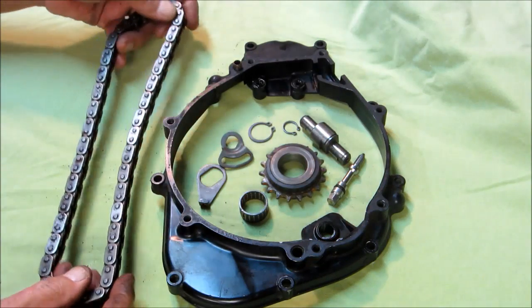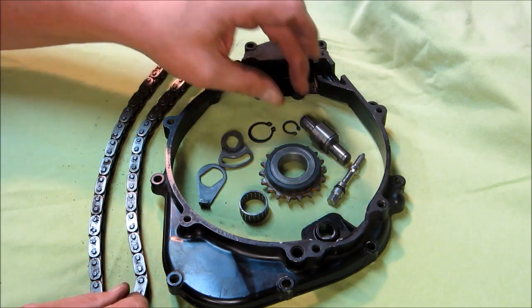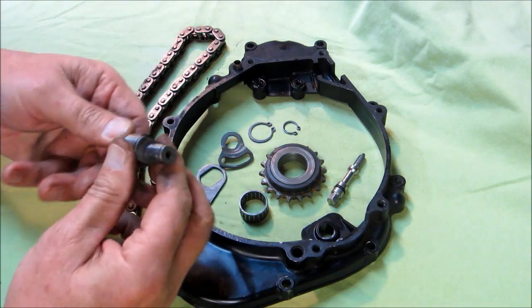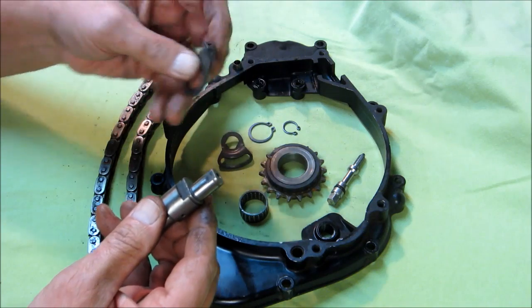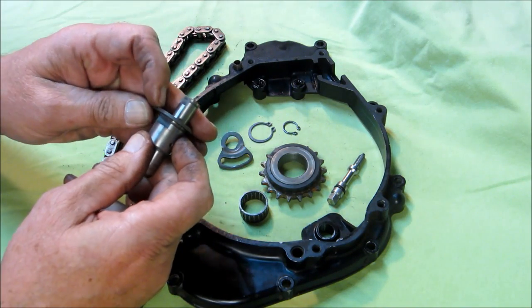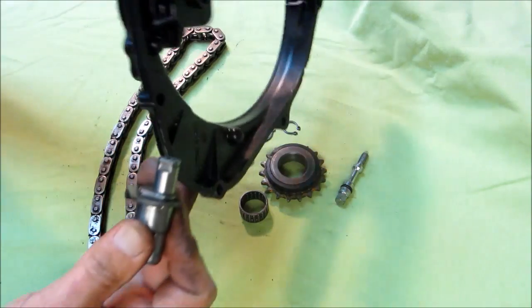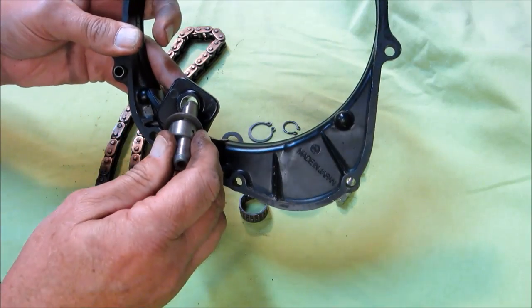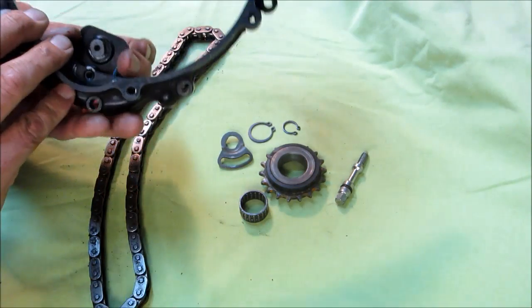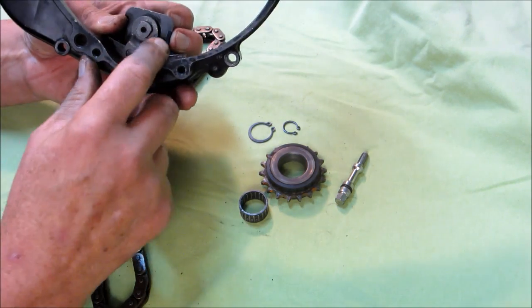And that's why we need to be able to adjust this thing periodically. What Kawasaki came up with for this system is an eccentric shaft, and on that eccentric shaft is mounted the adjustment lever that the spring attaches to. And that goes through the little case here. On the other side is what we've come to know very affectionately as the doohickey.